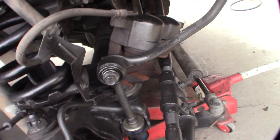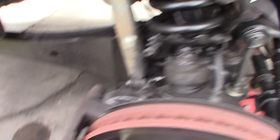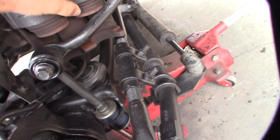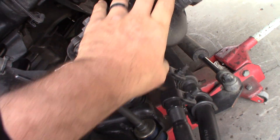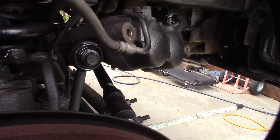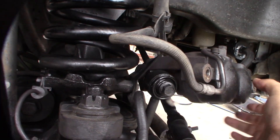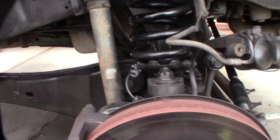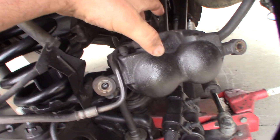Let's start with this thing. This is not going to be an in-depth review of how to get a brake caliper off — it's pretty basic. Let's get the caliper off. I usually store it on the sway bar — that's a good spot — so you're not putting tension on the brake line. It's two bolts, right there and there, and here and here. That's just to get that thing off. But like I said, you need to get the C-clamp on there to push it back a little bit, or it's going to get caught up in those nubs — you'll never get the caliper off.